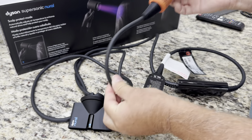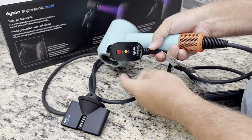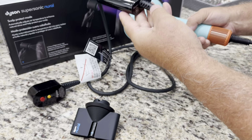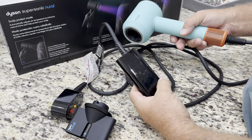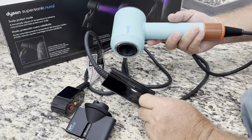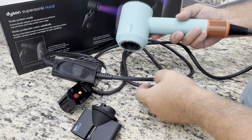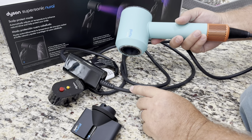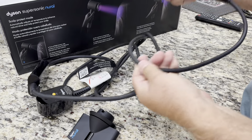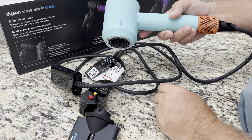The cord is ridiculously thick. It's got GFI protection right on the plug, the cord is very long, and it's got a DC converter — which is kind of interesting. I would imagine the motor is DC but the heat element is AC, so I bet that's what this converter is. It runs multiple wires — AC and DC — once it passes this point, and that's probably why it's so thick. It's not thick because it's handling an enormous amount of amps, even though it does — it's likely because of that AC/DC feature.